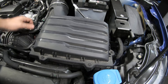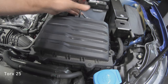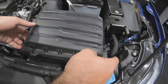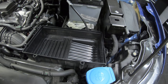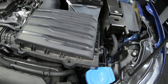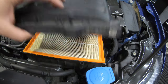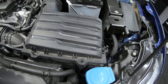The last thing we need to change is the air filter. This is held in by seven torx screws, and these are T25s. Just lift the top of the air box off and remove the old filter. It needs a bit of cleaning out, but this is actually looking pretty clean. Then grab your new filter, put it in, and secure the seven screws.